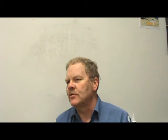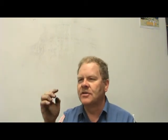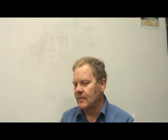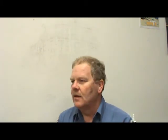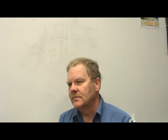You remember how points work? The points are closed, and while the points are closed, the coil is saturating. You got that, Sean? Yes, sir. The coil is saturating. When the points open and that saturation collapses, that's where your spark comes from. The longer you keep your points closed, the more coil saturation time you have.